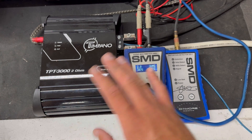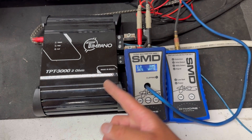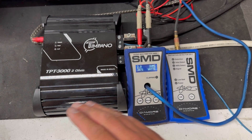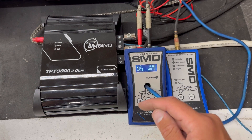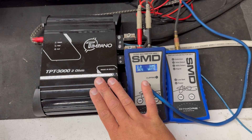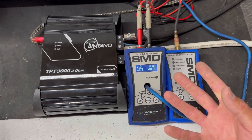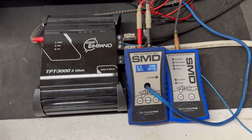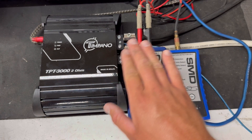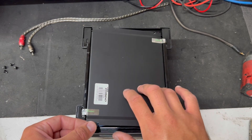This full-bridge amp may blend some frequencies together versus something like a half-bridge being a little more punchy, but it's going to be really hard to tell. Is this a good amp to buy? It's cheap and it's fun, and it's a good way to realize just how big a power wire you actually need for 3000 watts — because it's not a joke. While lithium batteries and big alternators make a little amp like this able to produce 3000 watts all day, it's still a lower-quality amplifier with some quirks you have to tune around. These are not really designed to last — some do, some don't. The numbers don't lie: if you need 3000 watts and you have the ability to power it, go ahead and try it out.